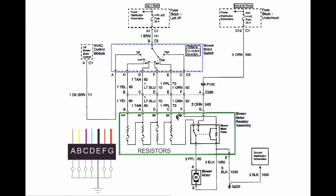In my era of truck, which is 2002, they found some of the components, or actually most of the components, were underpowered for the current needed by the blower motor. As the blower motor ages, they tend to pull more current, and usually it's because of the grease. The motor loses lubrication, or the lubrication that's in it finally starts drying out and becomes gummy, and it takes a lot more current to overcome that ickiness or weasel snot to get up to speed there. So that starts pulling more power, which means more electrons, which means more heat, and it starts overcoming the weak points like the switch contacts and the wiring harness itself, which uses some small pins.